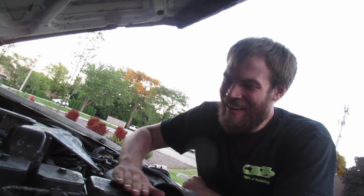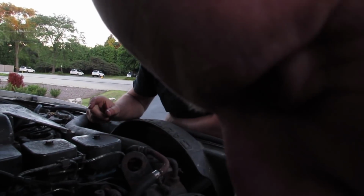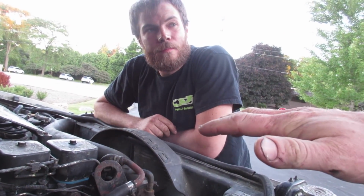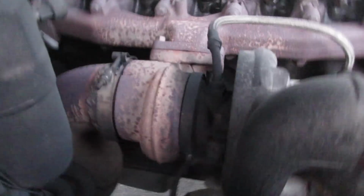On the flat side. If you torque it up, does it hit? It doesn't. It's real close there. But what I am gonna do is put a 1/2 inch shim, just to tilt it and raise it up a little bit. I think my 4BT was tilted just slightly to keep the oil pan away from the front axle. And then the mounts, you didn't buy? There are lots of kits to buy the mounts, but these are the 6.5 mounts.